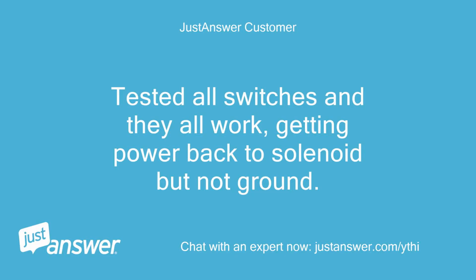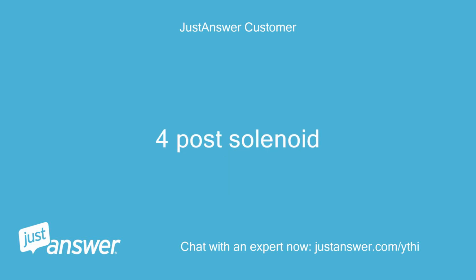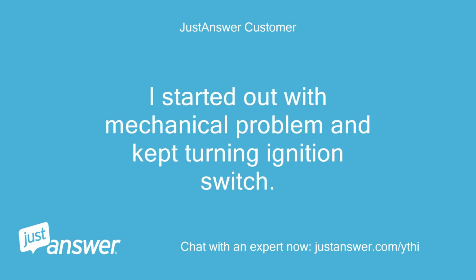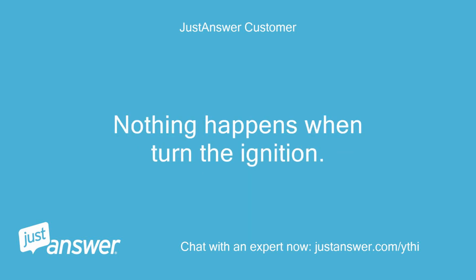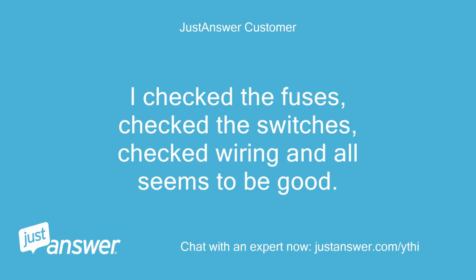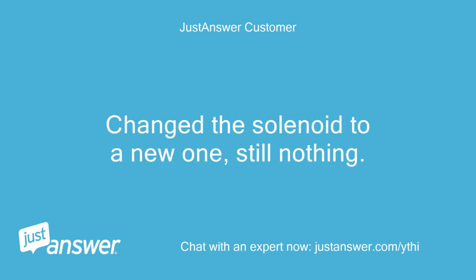Tested all switches and they all work, getting power back to the solenoid but not ground. 4-post solenoid. I started out with a mechanical problem and kept turning the ignition switch. I fixed that problem but then all of a sudden it wouldn't turn on. Nothing happens when I turn the ignition. I checked the fuses, switches, and wiring and all seems to be good. Changed the solenoid to a new one, still nothing.